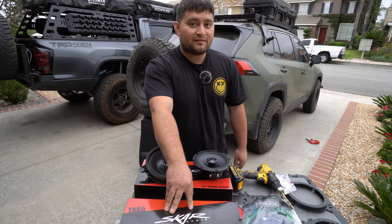With the three screws out, next thing you're going to do is down here on the bottom left part of the RAV, there is going to be a little bit of a lip where the door panel hangs off a little bit. It's good to yank on it to disengage the clips, so just give it a firm yank. And as you can see, the door is pretty much all the way out with just one good pull. Now with the door panel off and loose like this, I like to pop the handle out like that just to make it a little bit easier. And then I'm going to disconnect these two cables right here — they're push tabs and then they click out. The handle just has two little ridges that go in, and the front part slides in, and you just angle it out just like that.